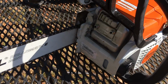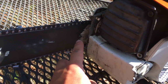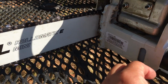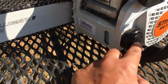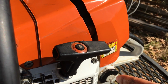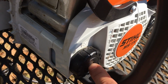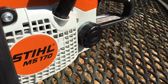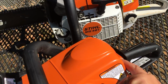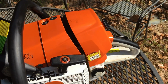So okay, one of the things I would say is these plastic teeth here are kind of scrubby, but they do work, versus real teeth on a chainsaw like that on a commercial version. And of course the gas, and this is the oil, and this is the gas fuel mixture reservoir. They're different. These have like a screw, kind of a cap, quick release right there. These are just kind of the unscrew, and then there is an indent here to stick your chainsaw bar tool in and get that open too if you need to. It has an internal filter in here, which you can take out and dust off. This has a solid filter that you can just take off and clean whenever you want to.